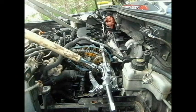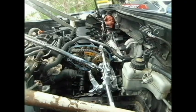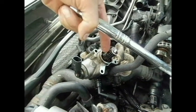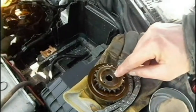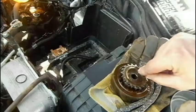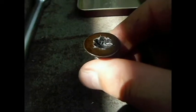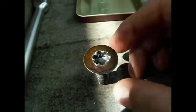It was 110 foot-pounds because I had put it on once before, and there it goes — just like that. One thing to note: I made contact on this spring, which is actually a loose part. The spring and the impact shaft will pop out, so be careful not to whack that. The pin on the camshaft adjuster is also a loose component that may fall out — be careful not to lose it. We've got a fairly substantially stripped camshaft adjuster bolt, and that's what the gear puller method helps eliminate. If you use that with the proper bit, you won't get as much of a problem.